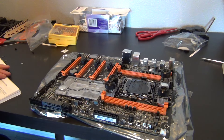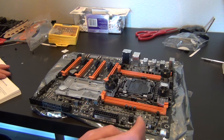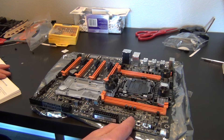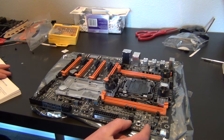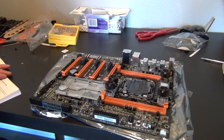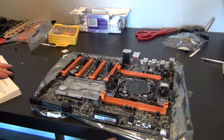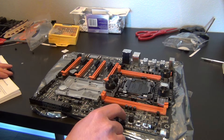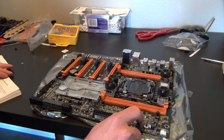This chip and this chip are going to be your BIOS chips, so you're going to have a single BIOS or dual BIOS, controlled by these two switches right here. You have the main BIOS and the backup BIOS, and above those are your power button, clear CMOS, and reset button.